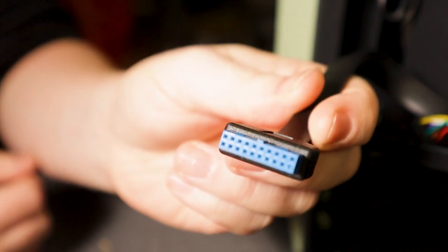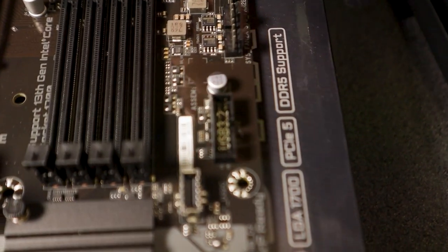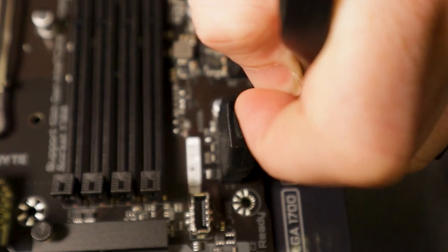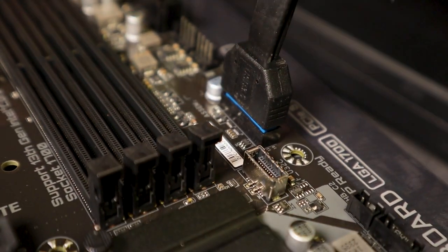On to number eight. The USB 3.0 header harks back to an age of PCs when building had way more risks — power supply switches were live, case edges were sharp as knives, and ports broke even if you looked at them the wrong way. Modern USB 3.0 header pins are super fragile, so make sure you present the cable to the motherboard the right way round and be gentle when connecting it. If you push too hard, the pins will bend and you will potentially lose use of that port.